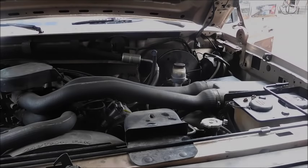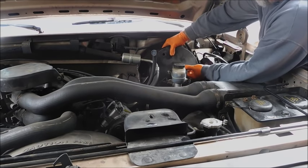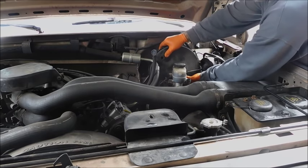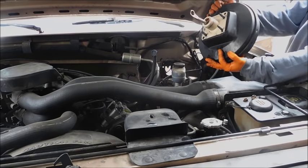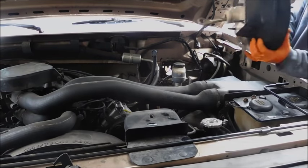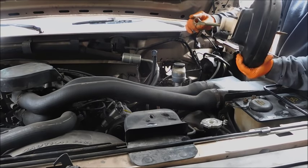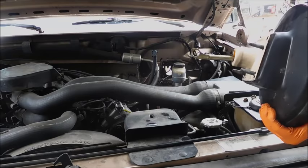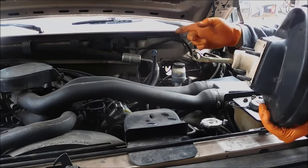At this point I'll pull those four nuts off the posts and the booster should pull right out. I removed all the nuts from the inside, so now I'll work the booster off the firewall and pull it forward. Now I'll work the new one back into the same hole, install the nuts on the backside just like this one had, and reattach the arm. Notice the arm is pointed up — I'll duplicate that orientation since the arm can turn, so that's how it came out and that's how it goes back in.